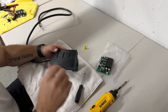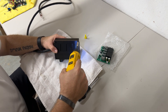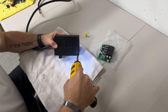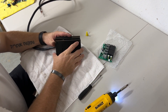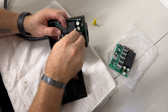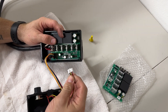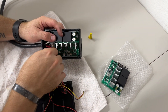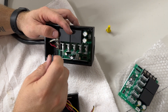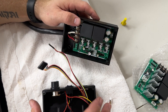To get started, remove the top four screws from the control box — you don't have to take them all the way out, just enough to get it loose. Once the cover comes off, remove the harness going to the on/off switch, then the two harnesses going to the speed control knob — just grab the wires and pull carefully. Then pop off the LCD harnesses the same way. Note that one is a five-pin and one is a six-pin; we'll get into that a little bit later.